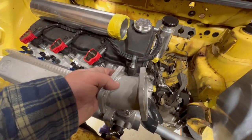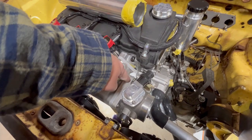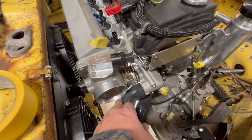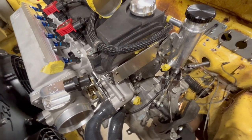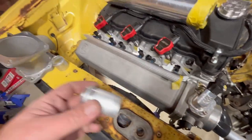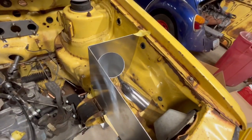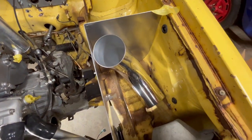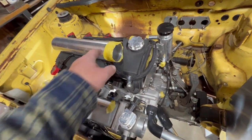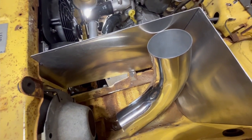With another silicone coupler it'll get past there. That's kind of why I had to run that hose down where I did. I did have to cut the beads off of that 105, but my buddy that's going to help me weld this up — weld this pipe into here — he's got a bead roller. So he'll bead roll that, and he'll bead roll this guy on both ends, and when I get this guy cut to length he'll bead roll that too. It's nice having a friend that has the tools when you don't and knows how to do it.